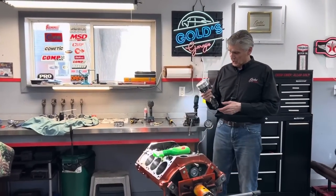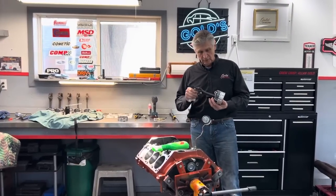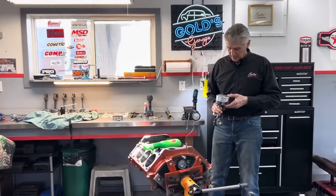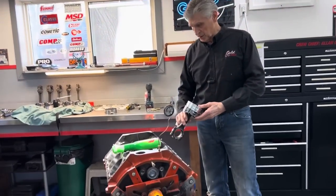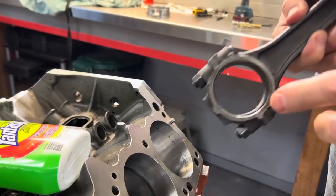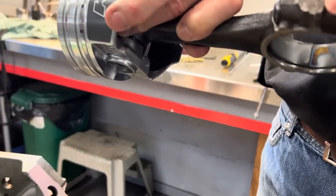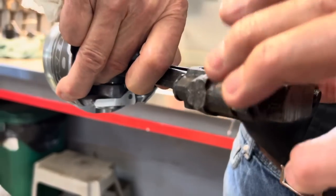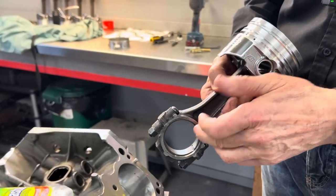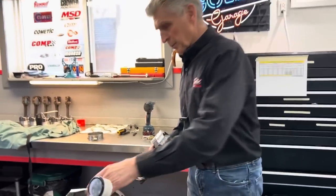In this clip we're going to show you installing spiral locks into a piston. One of the things you want to make sure of: this is a floating pin piston, so you need to get the pin in the right place and the rod in the right place. This is number four cylinder, so orientating it correctly — number four cylinder is at the back of the crankshaft, so you want the rod radius to be at the back. The numbers on the rod and cap line up of course, but the key point is that the valve reliefs are always at the top and the rod radius is at the back.